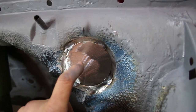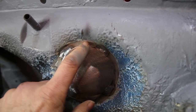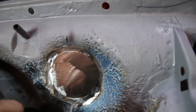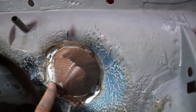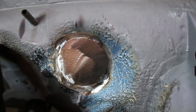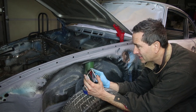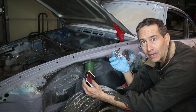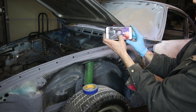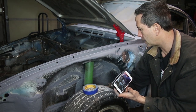This plate is a very lightweight plate — it's only a cover. I only welded it in four places; I don't see a real need to go all the way around it. I'm going to be filling it with epoxy primer and also treating it with epoxy primer on the backside, so I can just use epoxy primer and seam sealer around this and call it good. There's no sense putting a lot of heat and distortion into this. Now I'm watching a video of myself so I know where to put this brake bracket back on — it goes right there, in this orientation at the height of that hump.